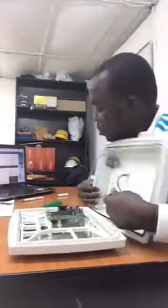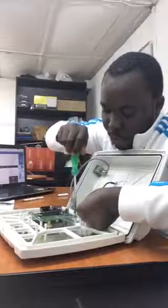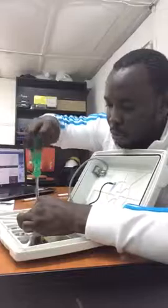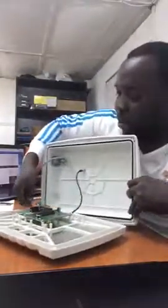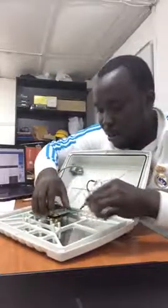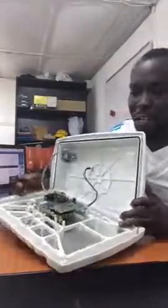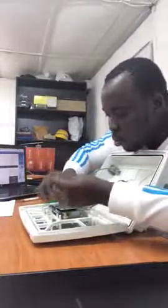We take this one using one of the nuts and simply place it here and screw it. The last nut goes to the other point. The Ethernet cable here goes to the port I told you about — just fix it. Then you take your wireless card and slot it into the space made for it. If you look closely at the wireless card, there are two small points you can connect to: one is main, one is auxiliary. You connect it to the main.